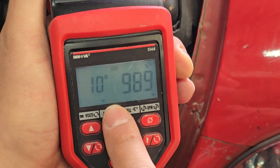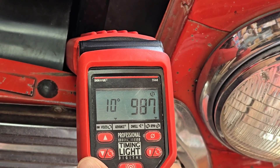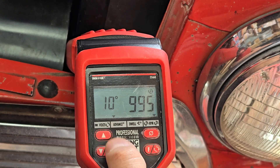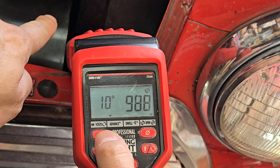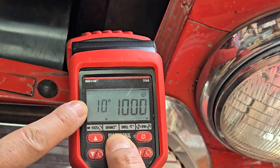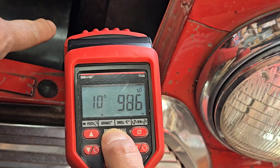Now let's go ahead and do the ignition timing curve plot. I'm going to rev it from 1,000 RPMs to 2,000, 3,000, 4,000, and 5,000, and I will adjust the up or down arrows on the dial-back system to position my timing mark at top dead center, which will tell me what the ignition timing curve is on this distributor. If you can't hear me, just watch this screen and I'll point to it whenever I've stabilized the reading.